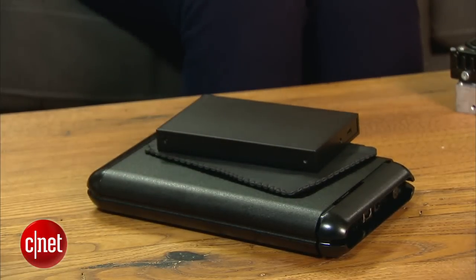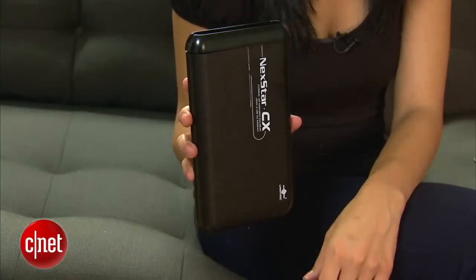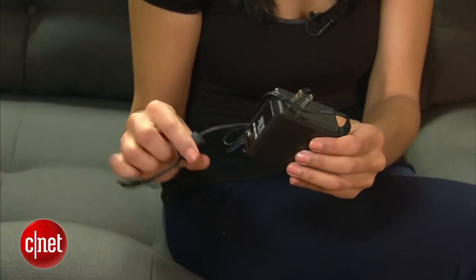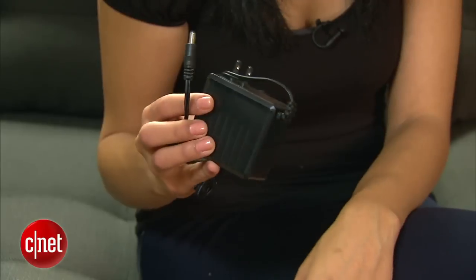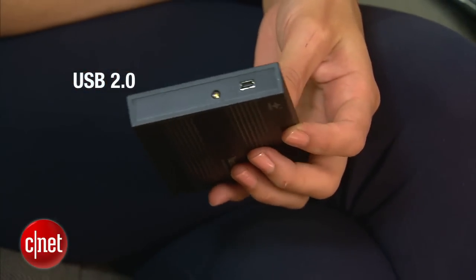Now that you know what kind of drive you have, it's time to start thinking about the enclosures. There are a few things you'll want to look for. First of all, make sure you're picking the right size for your drive. A 2.5-inch enclosure looks like this, and an enclosure for a 3.5-inch drive looks something like this. One difference you'll notice with this one is that it'll come with an AC adapter, which makes it a little bulkier and not so good for portability. Next, you'll want to pick your external interface — that determines what kind of connection you'll use to hook up your drive. In most cases, you'll go with a USB 2.0 connection because any computer can connect with that. But if your computer can take USB 3.0 or Firewire, go with that — those are faster connections.